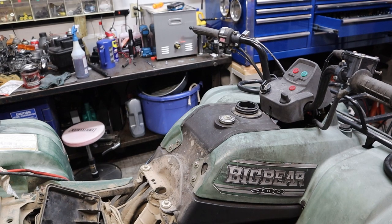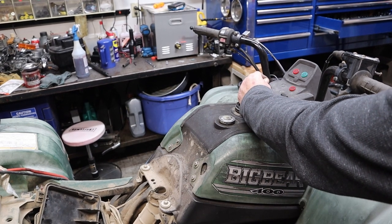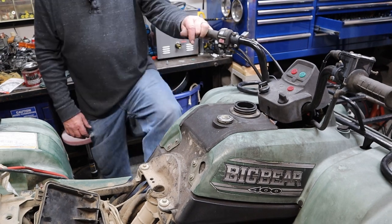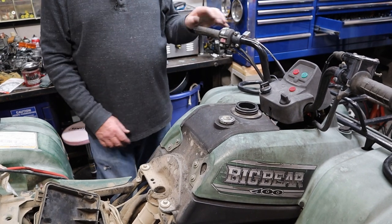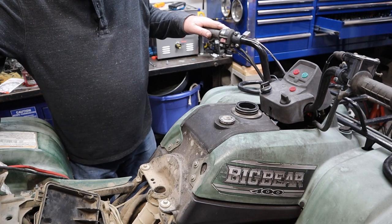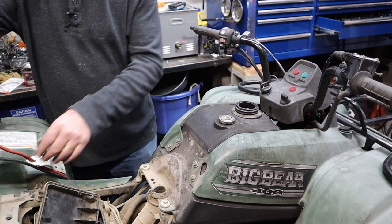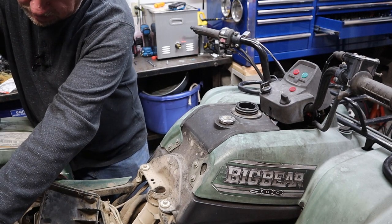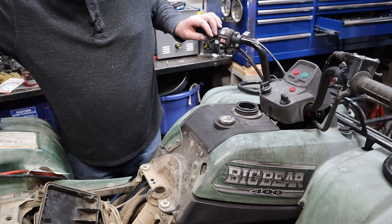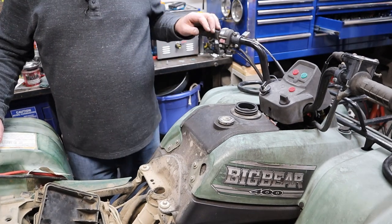We got our jumper battery hooked up, and we have zero lights whatsoever. Let me see if this thing's in neutral or not. Appears to be. I'm going to guess I got some pretty crappy jumper cables, or we're hydrolocked. One of the two. And hydrolock's probably a pretty good option. See if we can get this thing to roll over.